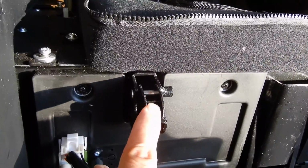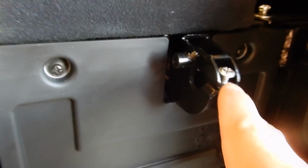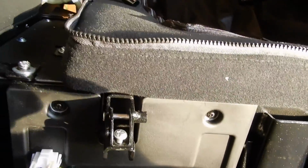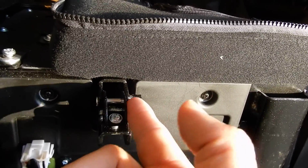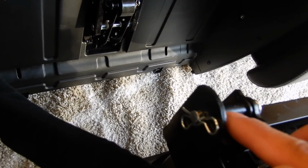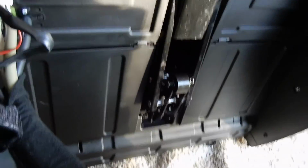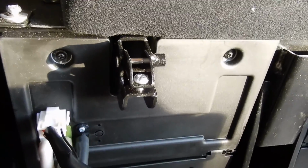Okay, now to position this onto the actual frame of the chair, you're going to have 2 screws on the left and right here, another one on this side on the right. If you're facing the chair, you're going to remove those screws, and then it's going to have a locking mechanism that simply moves up. You will insert this piece here of the leg massager and the other side, of course, right in there. Really easy, so we'll show you. Let's remove the screws first.